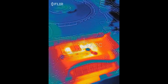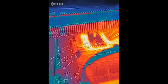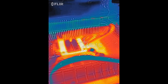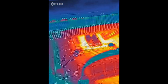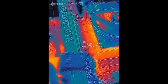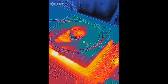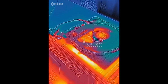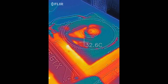So we'll put that fan back on there. The downflow is nice because you are pushing air across some of these components down here, adding to the cooling. And then if we look at the system here from the top, the intake temperature still a little warmer, and we are bouncing off the 99C, 100C upper thermal limit.